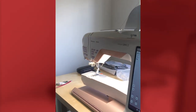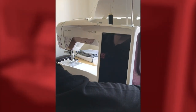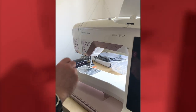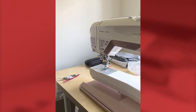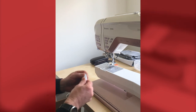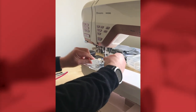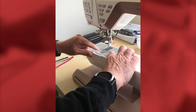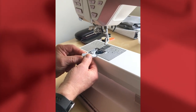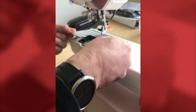This is Rose's EPIC 2 and we'll give it a quick service to keep you going. Remember, safety first: power off, power lead out, and we're going to remove the upper thread. Take out the needle using the multi-tool that comes with the machine, then take off the presser foot. To remove the needle plate, simply touch the button to pop up the bobbin cover, place it aside, then take the multi-tool screwdriver end, pop it under the plate in the corner, twist and it will pop up, then pull it up and away.